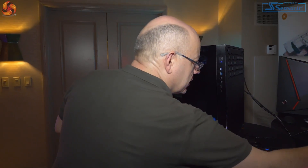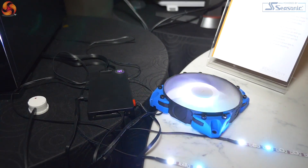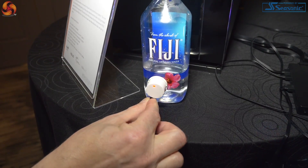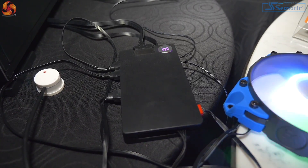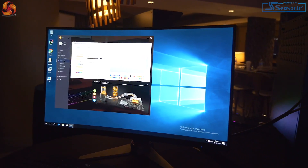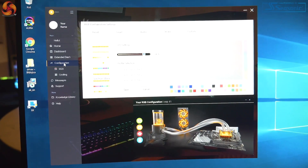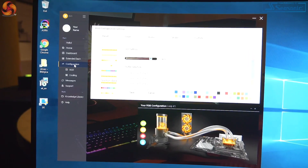And then we get to more RGB — EK Connect. This is their development controller. It can control six fans and there are some other bits and pieces it can do as well, including flow meter and such like. We use this and we can check the level — there we go, the light comes on. See? That means the reservoir is happy. And it goes up — oh, look, the level's dropped and now we've got a problem. And that will send the signal back to the controller and it will tell it there's an issue. We've also got a demo of the software they're working on. This is the development version of EKWB's control software — obviously RGB we know about, but in addition there's also a cooling section for controlling your PWM pump and also flow meter and water level. It can also report on CPU temperature, taking the info directly from the CPU sensor — that's not a coolant temp reading.